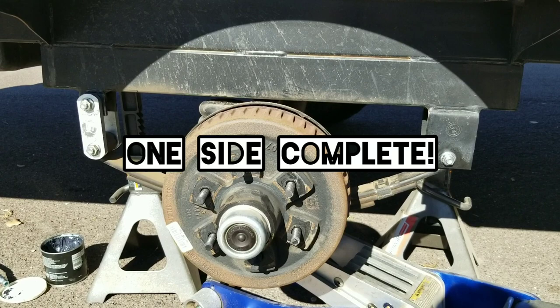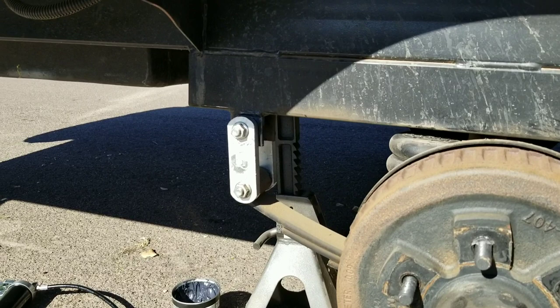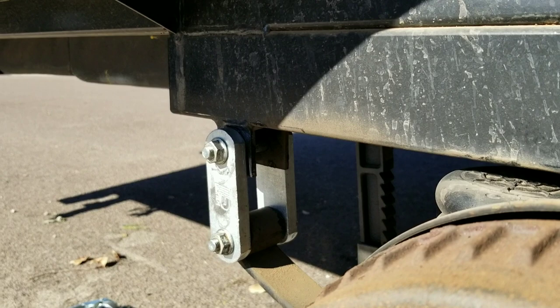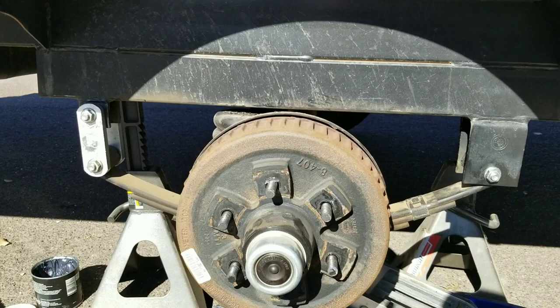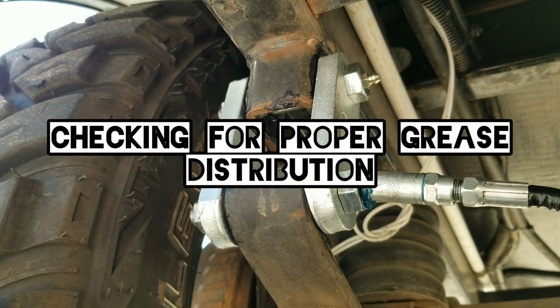The job is complete. Everything bolted up — once I put the front shackle bolt in, everything was pre-aligned and slid right into place. I greased the top one the best I could with moly grease, but without a steel tube it's still a problem. I'll probably buy the right diameter steel, insert a tube, and make it properly greasable next service. For now, I'm going to do the other side and then we'll see if all the squeaks and noises are gone.